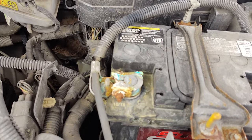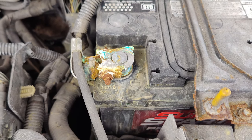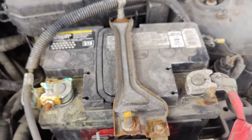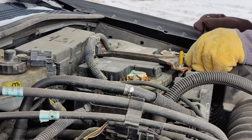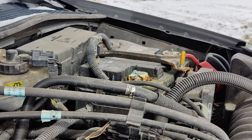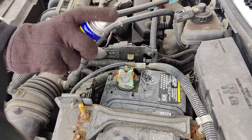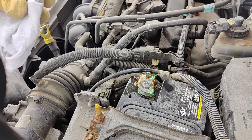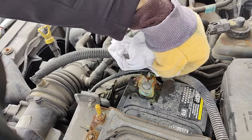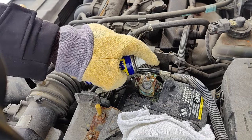The bad thing is the battery is corroded — it's got a lot of battery acid on there and stuff, so I've got to clean that up, but I can't find my wire brush. The first terminal came right off because there was no corrosion. The second one I tried and tried and it would not come off, so I soaked it with some WD-40, came back in a little bit and tried again. I wiped off some more of the corrosion and sprayed it one more time, let it soak for another five minutes, went inside to get warm, then came back.